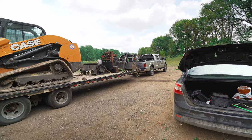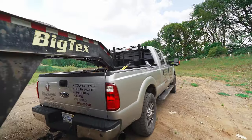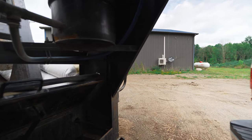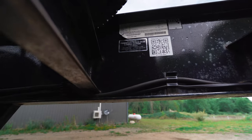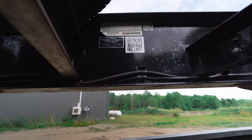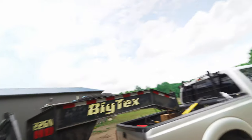The only other thing I wanted to touch on is you need to look at the tag on your trailer. The tag is up in the gooseneck — this tag here lists all of the information on your trailer. The key number you're wanting to look at is the GVWR, which is basically the gross weight. You need to understand that that number includes the weight of the trailer, which is also listed on that tag. To find your payload, subtract the trailer weight from the GVWR — that is your payload, and it's really important to know that number because that's what's going to get you a ticket if you go over it.